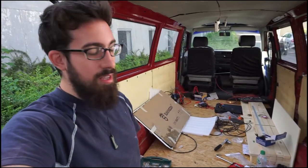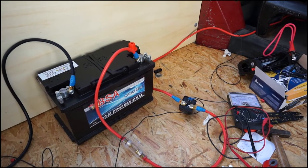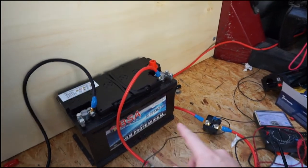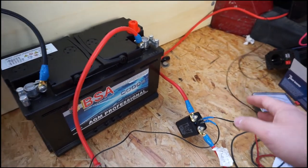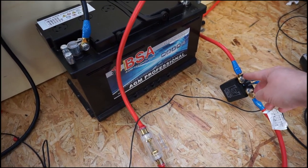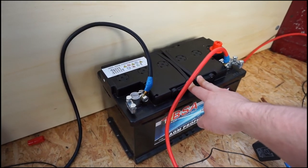Good morning guys, great weather means I have lots of time to work on the bus. I just wanted to quickly show you the progress from the last two days, which involved mostly electrics, wiring, and battery stuff. The first and most complicated thing was setting up this second battery — this one is connected through a wire to the starter battery, and this relay right here, with a signal cable, ensures that only when the engine is running is this battery being charged as well.